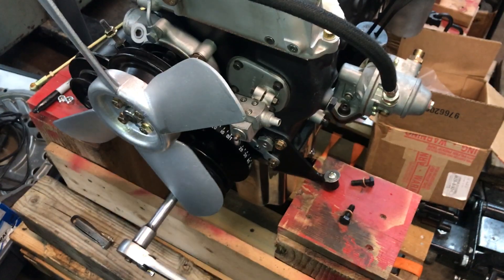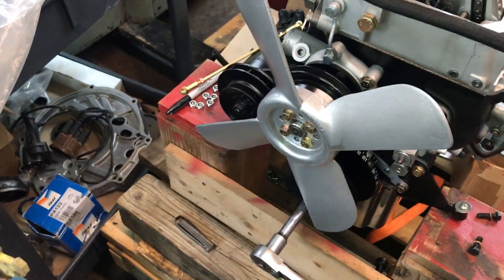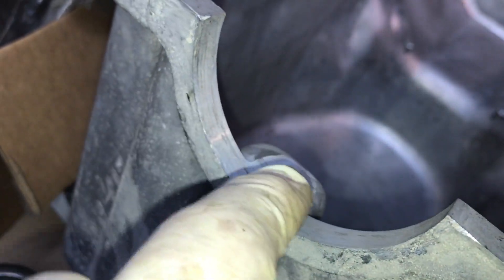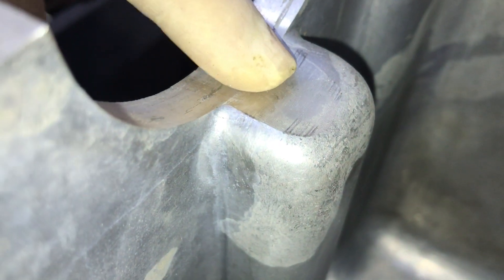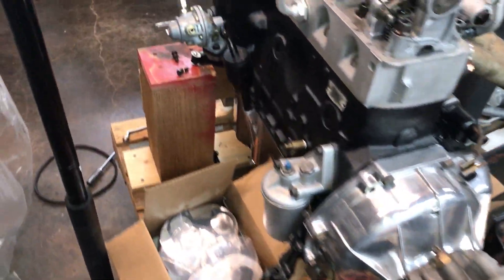Not that it really would, when things are zipping along. Let me get the camera off and I'll show you what I was talking about in terms of the oil pan. Here's the oil pan, and here's where the chain rides — you can see it's machined out so the chain has clearance. That's why the chain is never going to come off at the bottom; it can't. The clearance down here is so close that you actually see a light track from the chain having run there previously — that's how close it is. So even when the chain is loose, it's not going to come off. It may drag on the aluminum and make noise, but it's not coming off.